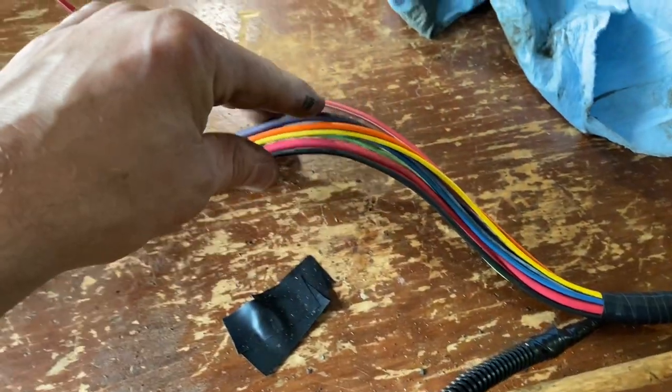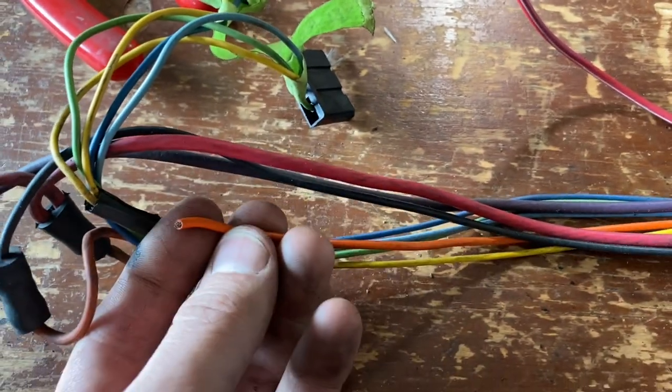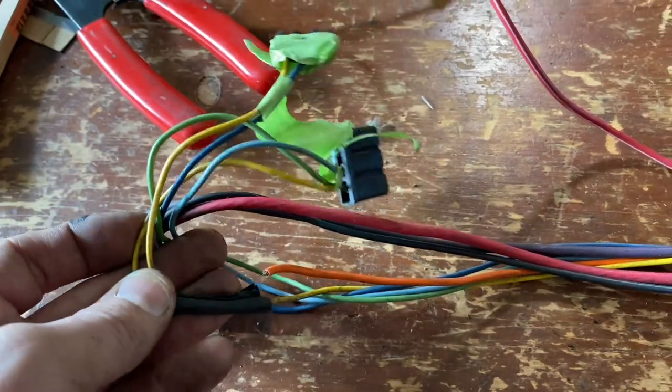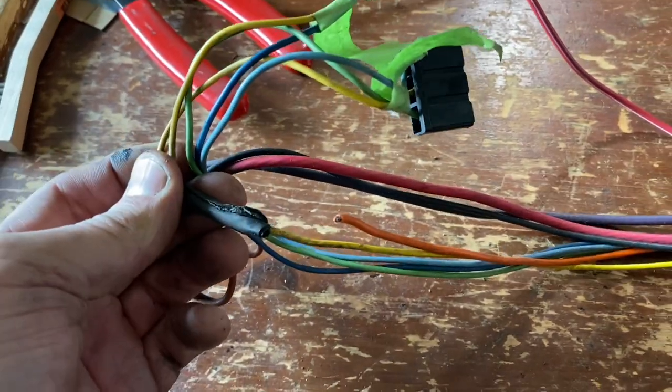I checked all these wires and everything looks good, but I did find one wire that somebody cut — so we'll have to investigate that. I also found one near where it goes to the wipers, I believe — somebody did that to it. We're going to cut that open and investigate it. This wire here I'm not too worried about because it's just one wire. Somebody eliminated the air conditioning in that car, so maybe it's something to do with that. Anyway, I will remember this wire when I put the harness back in and get everything working. I'll leave this out and put tape around it so it doesn't short out.